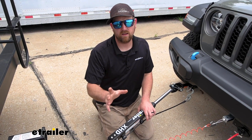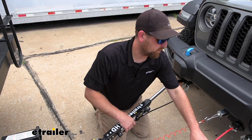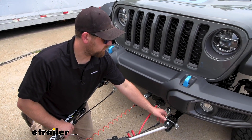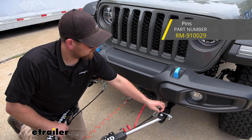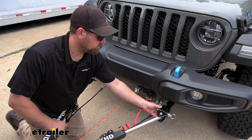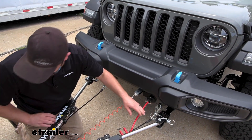Something I do recommend: if you're going to be storing this on your motorhome, it's probably not a bad idea to pick up a locking hitch pin. That way it'll be secured to the hitch and no one will be able to just pull the pin and take off with your new tow bar. One thing I do want to mention: in order to get the tow bar to actually pair up with your base plate, you are going to have to grab the pins separately. You can get them here at eTrailer — not really a huge deal, it would be cool if they came with it, but it is what it is.